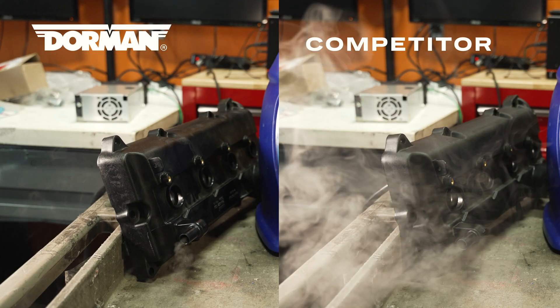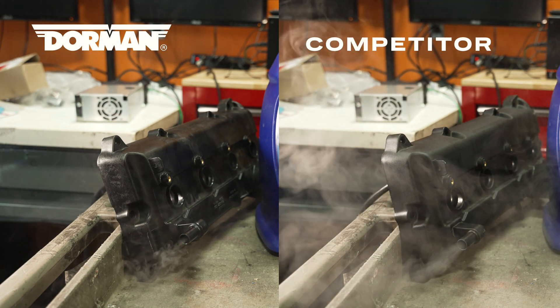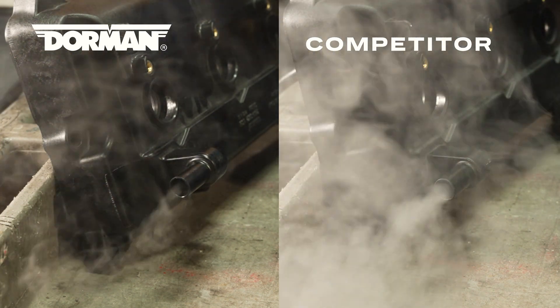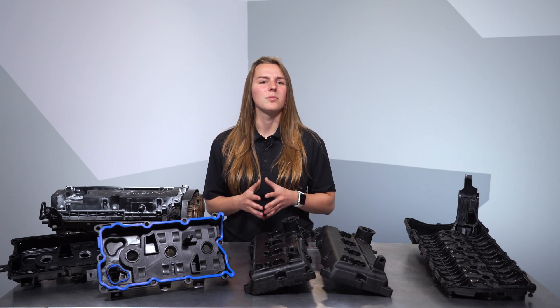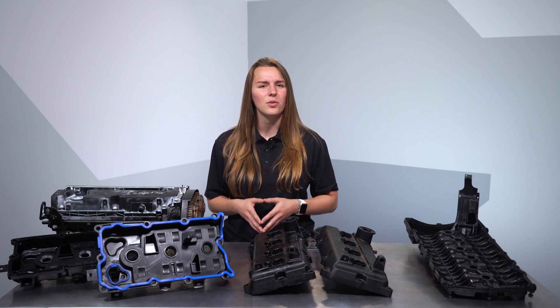The amount of oil carryover here is excessive and is definitely enough to muck up the works. We carry out smoke testing like this specifically to understand how the valve cover works before we can engineer a replacement. Something as seemingly minor as an orifice you'd never see on a competitor valve cover might just be enough to cause months of tail-chasing trying to find out why a car isn't performing the way it used to. We know this, so we take the time to engineer our valve covers to function exactly as intended.